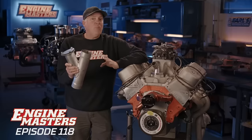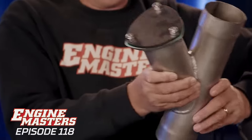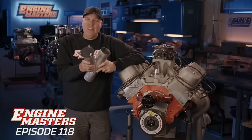This goes way back into the 50s. I think my personal first awareness of the exhaust cutout was probably in the Max Wedge Superstock Mopars of the early 60s. They came from the factory with these crazy iron header style exhaust manifolds, and yep, they had cutouts just like this, a straight piece of tubing with a cap that you remove to bypass the exhaust system.